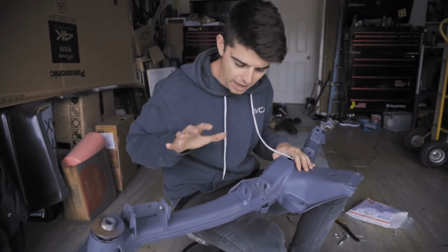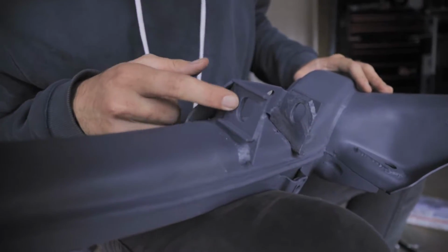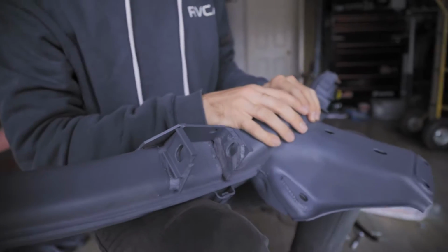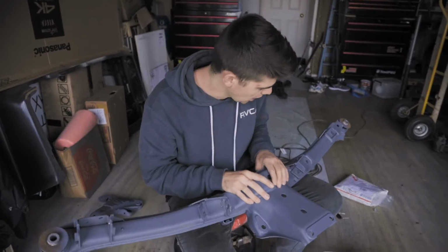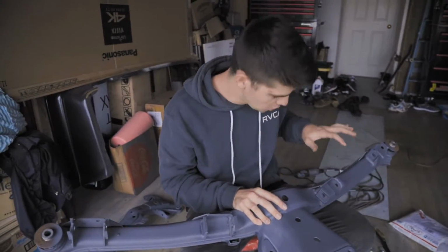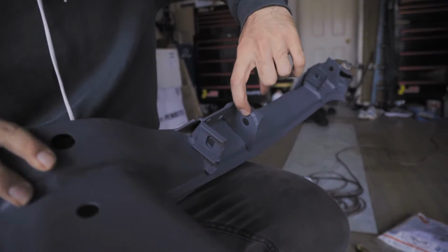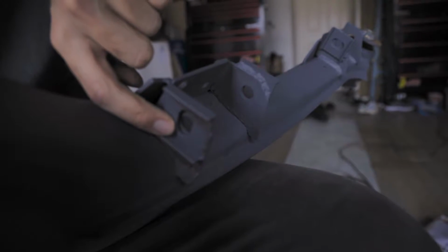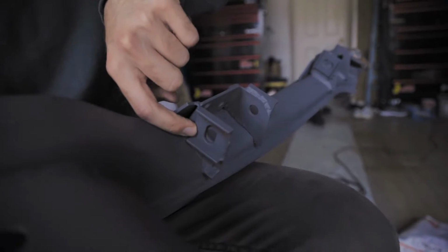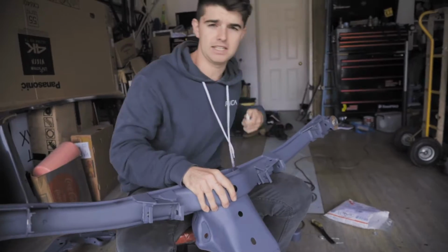And my favorite, and what we're working on right now, is these toe and camber plates. These have been welded in, and I've started to Dremel out the holes so that they're a nice oval, because on your E30, on the rear, you don't have any camber or toe adjustment, but this means with these plates that you do. See the standard holes here, which haven't been Dremeled out yet. It's just a normal hole, but on the other side of it, you've got an oval there. So what we're gonna do now is continue Dremeling out these holes so that they're a nice oval, so we have the adjustment with our eccentric bolts.